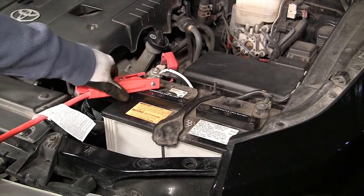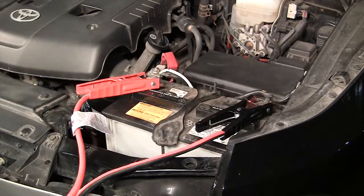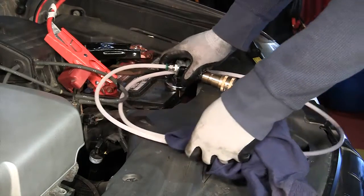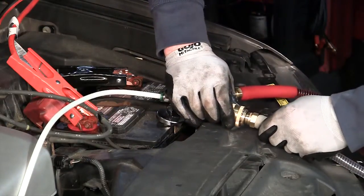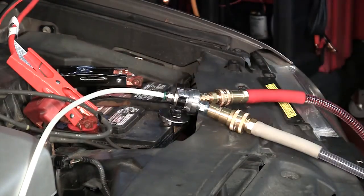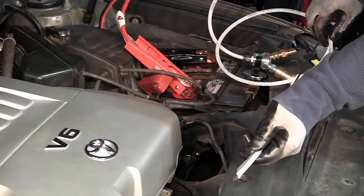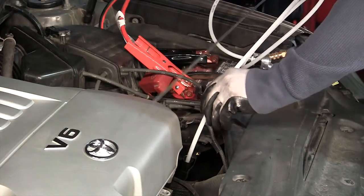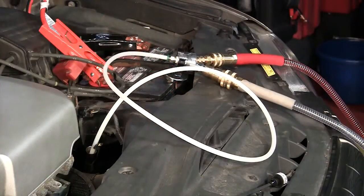Connect the machine's battery cables properly to the vehicle's battery. Connect the unit's red and gray service hoses to the supplied dipstick Y manifold. Measure the machine's dipstick hose against the vehicle's dipstick wand and insert the dipstick tube the same measurement, making sure you reach the bottom of the pan.